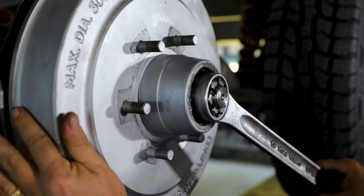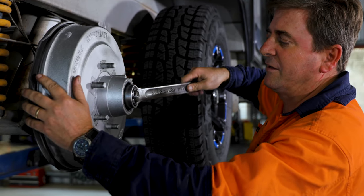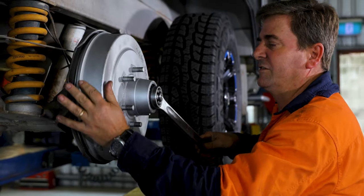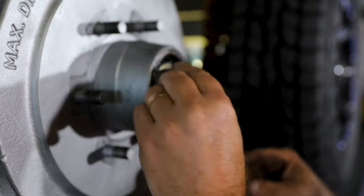There are cross holes in the stub for finer adjustment. So we just back it off until it comes loose. That's a bit too loose on that hole, so we bring it around to the next hole — it's nice there. There's no back play.